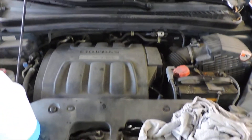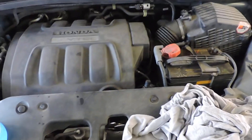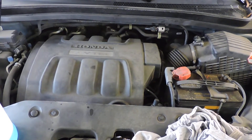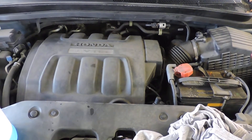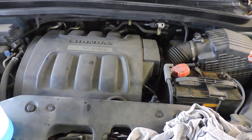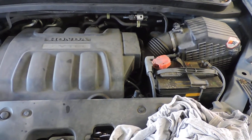We took the car for a ride and everything's fine. I checked the transmission fluid level when I came back and it was good. When I finished filling it, I put in maybe another eight or ten ounces from the fourth quart, since it called for 3.3. I didn't want to overfill it, but I also didn't want to crawl back down to that fill plug and add more. I guessed right. I put the drain plug in, filled it up with the funnel, put the fill plug back in — both are tight and don't leak — and then I turned the car on.